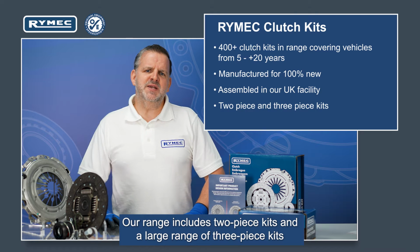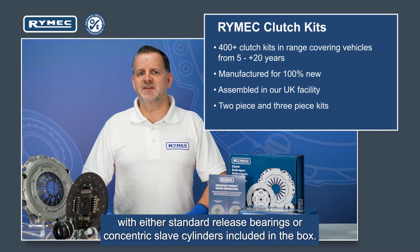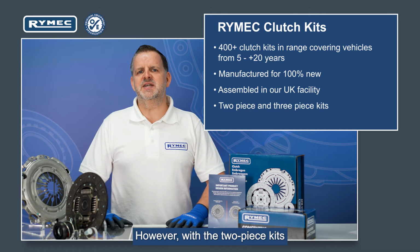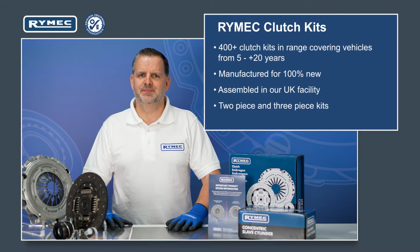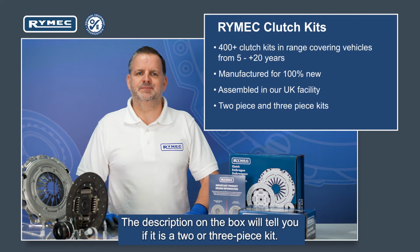Our range includes 2-piece kits and a large range of 3-piece kits with either standard release bearings or concentric slave cylinders included in the box. However, with 2-piece kits, we would encourage the installer as best practice to always replace the concentric slave cylinder at the same time. The description on the box will tell you if it's a 2 or a 3-piece kit.